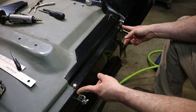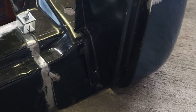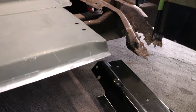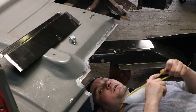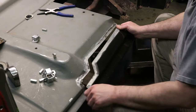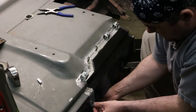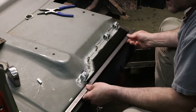This side's fitted, this side's fitted. All I have left is trimming this area down — the cab corner's done. Just kidding, I still have to weld it in. No matter how much of a pain it is, make sure you clean your metal from both sides. Let's get this thing in place. It looks like it's exactly where it needs to be, but looks can be deceitful. Another important thing is to measure all these lines as well.